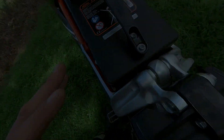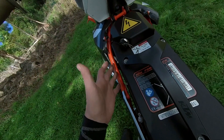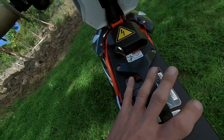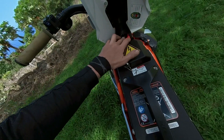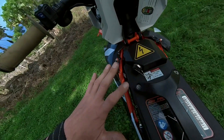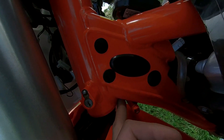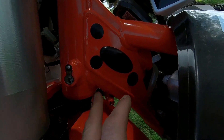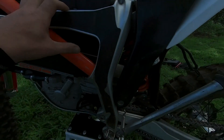Don't avoid jumping it just because it bends a $24 shock bolt — who cares. The frame is more of a trellis style, like you'd see on a 690 Enduro or a Duke, so the battery can fit inside. I jump mine a lot so I inspect my frame a lot. When the battery's out it's a great big hole and you can stick your head in and inspect all the welds. I look for paint flexing — from old motocross days I had a boss whose sponsored Yamaha riders would flex the paint off the steer tube from frame stress, so I check all those areas.